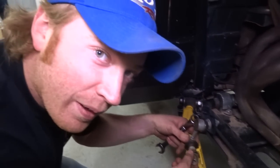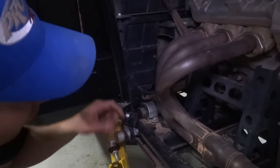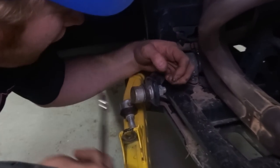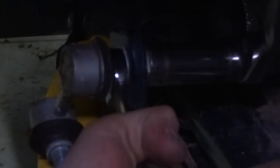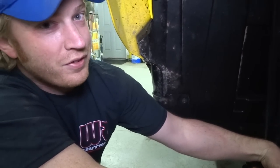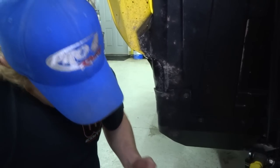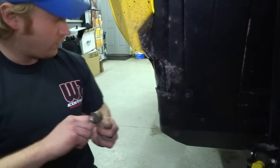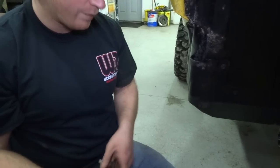This is all pretty self-explanatory, right? We're taking the stock sway bar links off. You can see this one right here - you got a 19-millimeter nut on the back side, and on the stud there's a couple flats, that's a 17 mil. If you have a 17-millimeter wrench, you can just slide it in there. Man, what are you doing with this exhaust, dude? We got a pretty cool exhaust coming for this thing - I don't know if I want to let the secret out yet, but you guys might shit a brick. It's still just a regular exhaust, no turbo attached to it. Stock links are in pretty decent shape - they look pretty good, they're pretty tight.